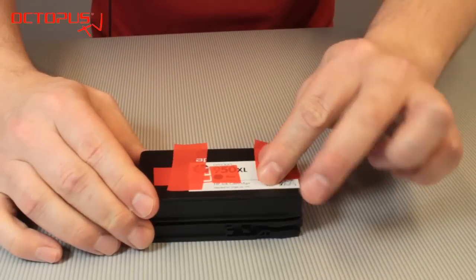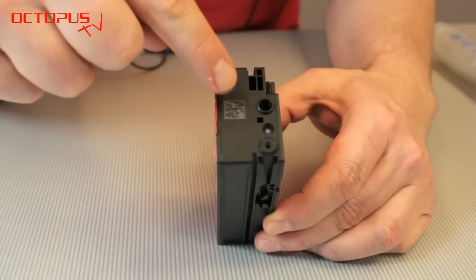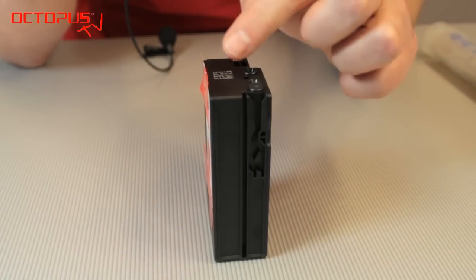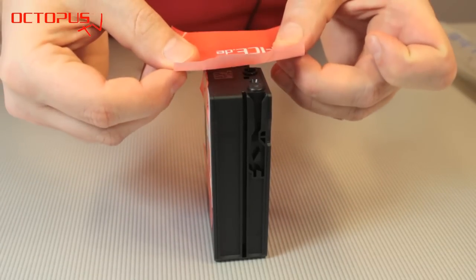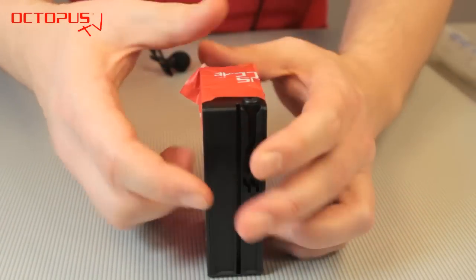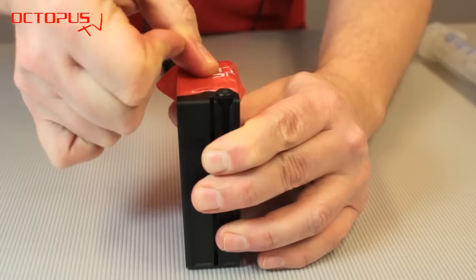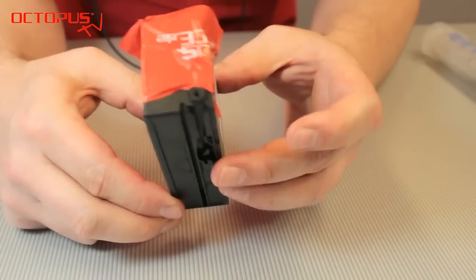Press the tape to the surface properly. A bit more difficult is to seal the air openings at the front side of the cartridges, as you have to apply the tape around the corners and also level it around this round opening that is not flat on the surface. Pull it around this corner tight, and finally use the flexibility of the tape to get all of these openings sealed tightly. Actually it doesn't look that nice but it works fine for our purpose.